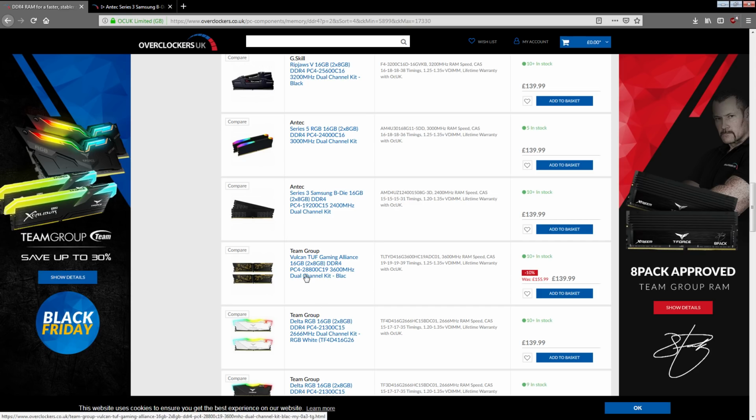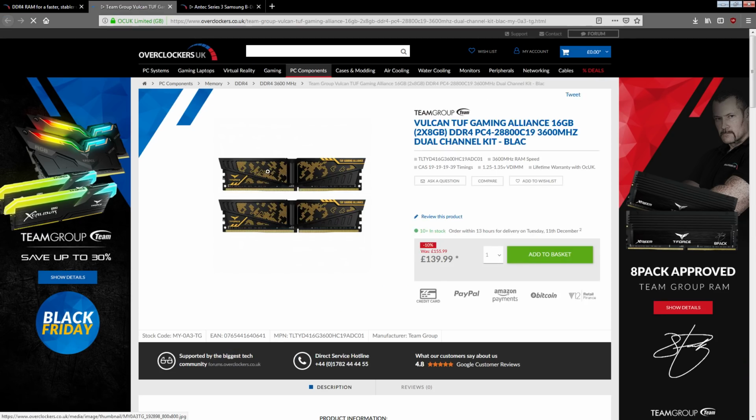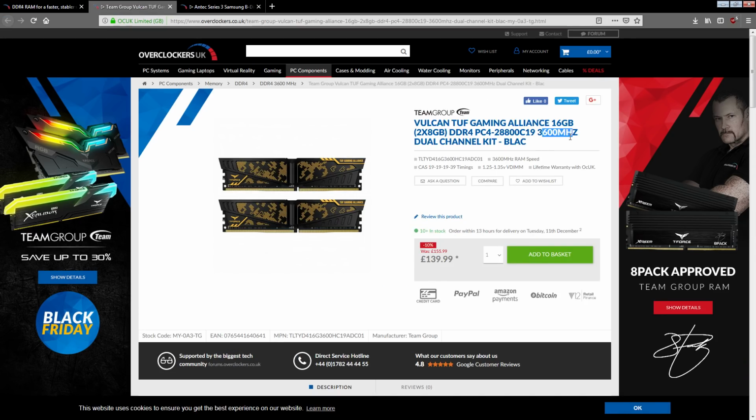Right off the bat, you can get this: 3600 CL19, or this, 3600 CL19, or this, 3600. You get the idea. If we actually look at it, it comes with heat spreaders, it's spec'd at 3600 megahertz, and this set of timings, 19-19-39, as far as I know, is an indicator that this is either Hynix CFR or CJR, both of which work relatively well on Ryzen and should be able to run that 3600 megahertz 19-19 profile. Or you can knock it down a notch and tighten up the timings. If you pump up the voltage, you should be able to tighten up the timings as well.